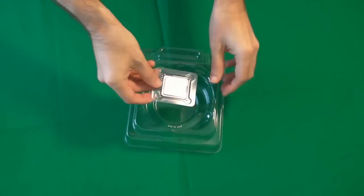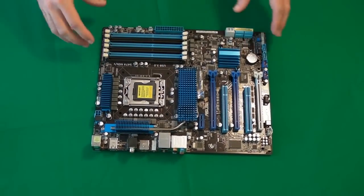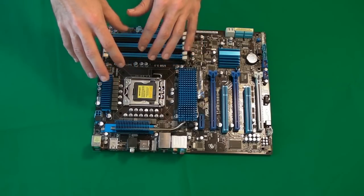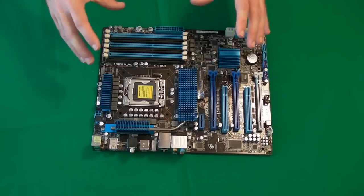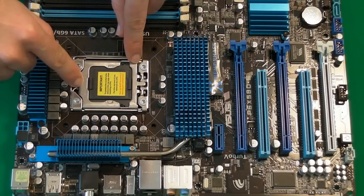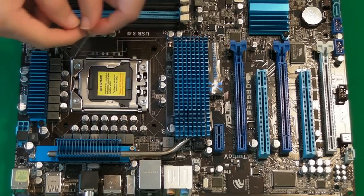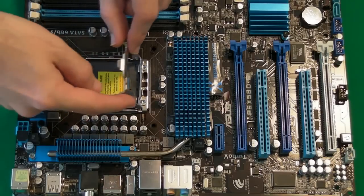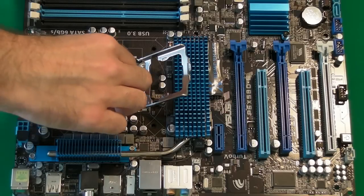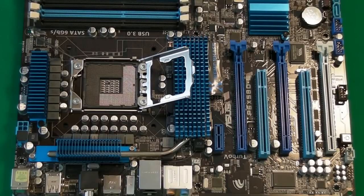One of the tips I received from a friend was to actually install the processor onto the motherboard before it goes in the case. This makes sense because it means you're obviously not working in that confined area. So I'm going to install the CPU and the cooler on the CPU before I put this into the case. This is the area where you install the CPU. We've got a little arm here which we take out of the latch and swing around, then remove this metal cover, and then there's a protector plate which we very carefully lift off vertically so you don't bend any of the little pins inside.